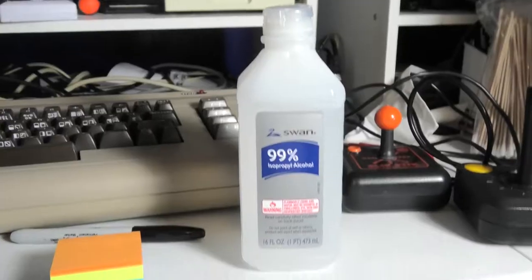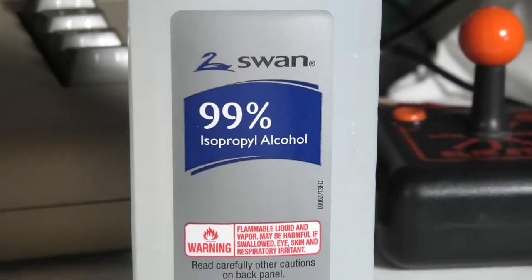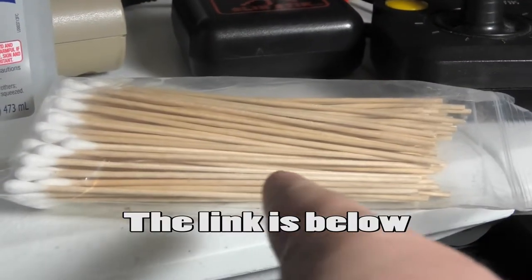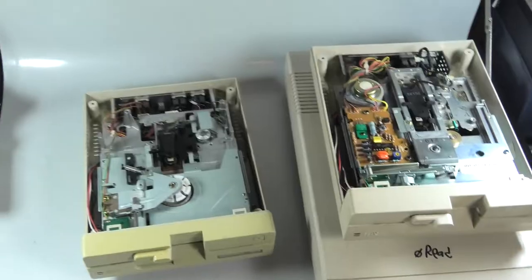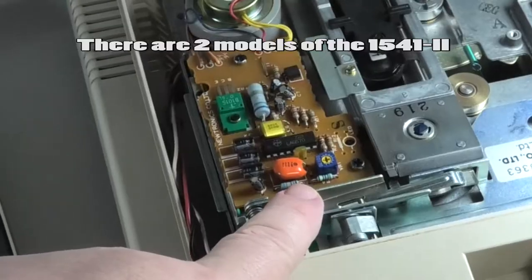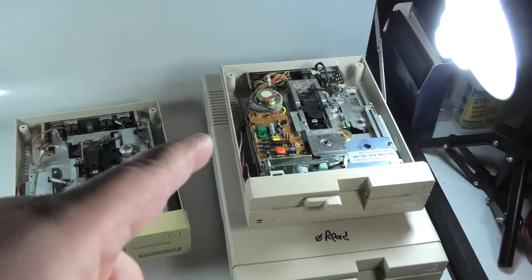Supplies we're going to need: isopropyl alcohol. The higher the number, I feel, the quicker it evaporates. So I like to use 90%, 99%. I don't use Q-tips. I use electronic cleaners. I'll put a link in the description. I get these off Amazon. They're really nice. Also note, there are two different types or manufacturers of the 1541 too. I prefer this one. It has a speed adjust right on top. That's the Mitsumi. But anyway, they all clean the same.